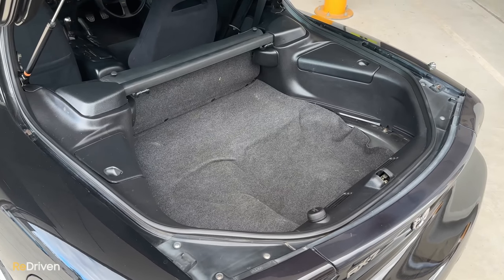The headlights and taillights can build up condensation, which actually affects the performance of the light itself — get that checked out or replaced. There are a few reports of rust — not a major concern, but it can happen around the edges of the doors, around the wheel wells and wheel arches, the sills under the rear taillights, the spare wheel well, around the bonnet hinges, the rear hatch, and behind the rear bumper. The door handles can have issues with coming off easily. And occasionally the pop-up headlights — even when you turn the car off — can just continue to pop up and down, generally just the relay inside the motor actuator. Try to avoid running into anything, because especially on the Series 8, the front bar and the rear wing are bloody expensive. One of the big problems is dodgy repair work, so make sure you check out the car's history as much as you can.